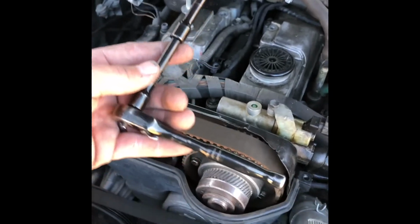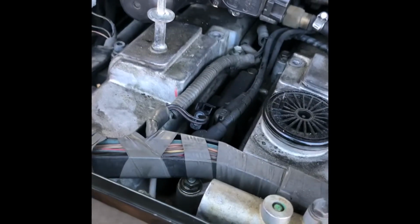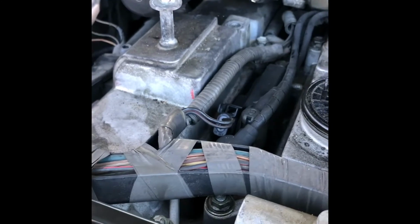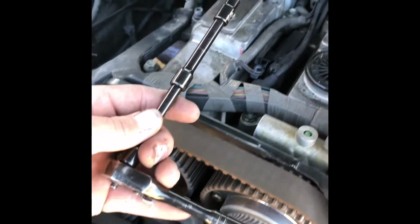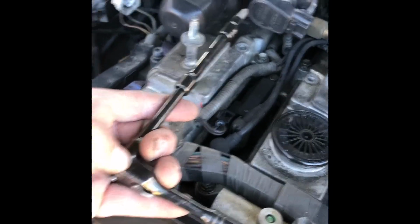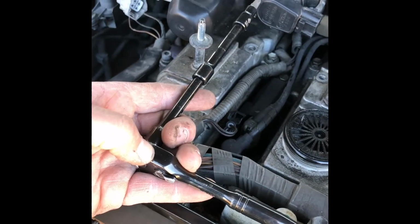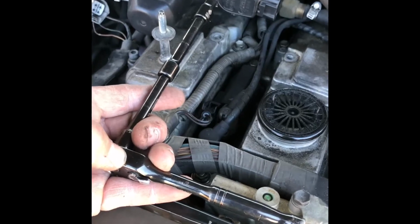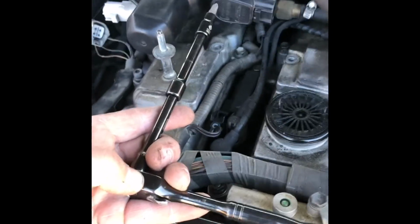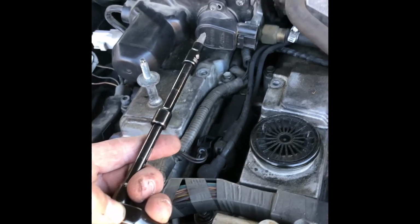Okay, well, I do strongly recommend rigging up a little wrench like this. See, the deal was that bottom screw is hard to get a good fit on with the regular screwdriver. So with a setup like this, what I'm able to do is put it in there, and back here on the head of the ratchet, I'm able to push so that it doesn't strip out. It comes out nice and clean. So I do highly recommend something like that, because trying to get a screwdriver in there and turning on it, unfortunately, you're gonna possibly end up messing the Phillips head screw up. So, alrighty, I'm gonna go ahead and get those screws out and come right back.